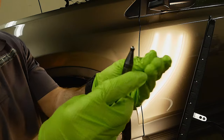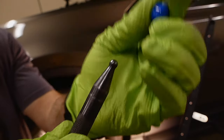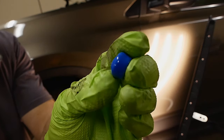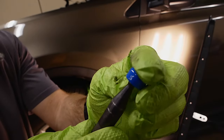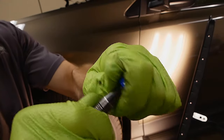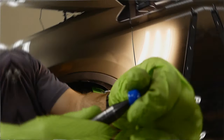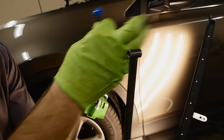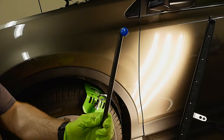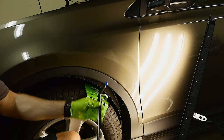To start pushing out the large damage from inside, I want to start with a large tip — I have a Dent Craft tip here with a large rubber cap. The reason I like this is it attaches right to the tip of the tool and also has some movement and flexibility, so when I'm pushing from the inside, it'll push flat and not push on the edge of the tool. I've got an extension on here along with the tip, and this allows me to push flat and move a lot of metal.